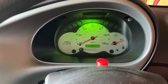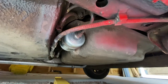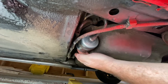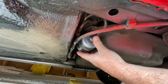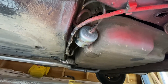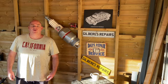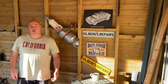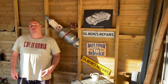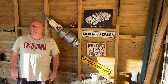So it should be good to go for another 12 months. The car is running, we're checking the fuel filter under there and it's dry on all the connections. It's important that you do this because if you've got a weep of fuel it's explosive, so make sure it's dry whilst running. I think you'll agree it's a very basic task to change your fuel filter. Just make sure you've got your washing up bowl or catch can below to capture fuel. If you've found it useful today and it gives you the confidence to carry out the task yourself, could you like, subscribe and share? And I'll get you next time.